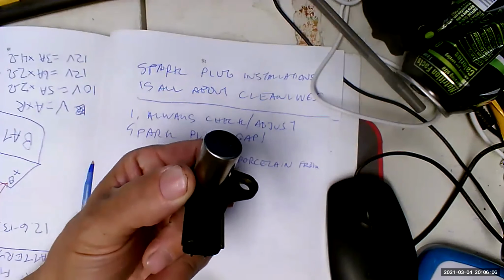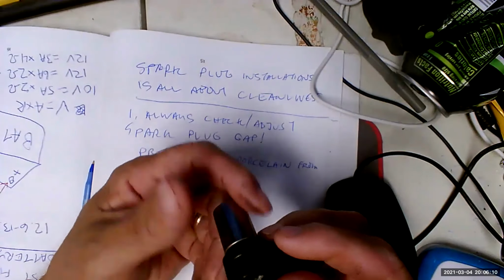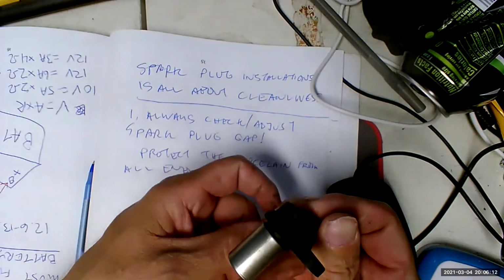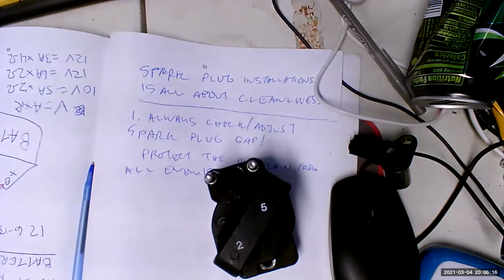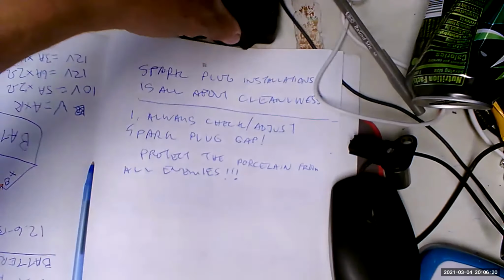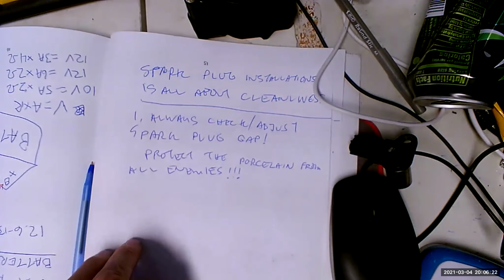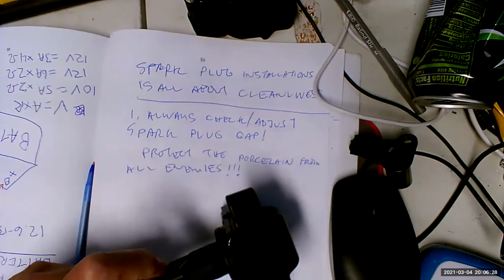Oh, did I show you this? That right there is a camshaft position sensor. You see it's got 2 leads. Yeah, it doesn't look like a pickup coil, but that's what it is. That's how it runs. This right here is the coil off a distributorless ignition. That's what I wanted to show you was coil on plug, just like that.